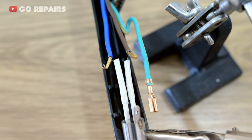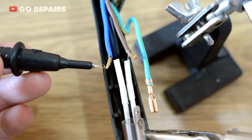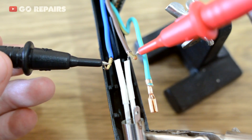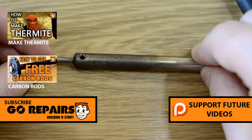The only thing left to check — and thereby the fault in this case — is the heating element. I want you to appreciate the irony that the wires connecting the element to the cable are soldered, so I'd need a spare soldering iron to solder on a new replacement. The heating element is basically just a coil of wire, so we use the same buzz test and it makes no noise — so I know it's had its day. If the manufacturer had replacements I could just replace it, but they don't, probably because they want me to buy a new unit.